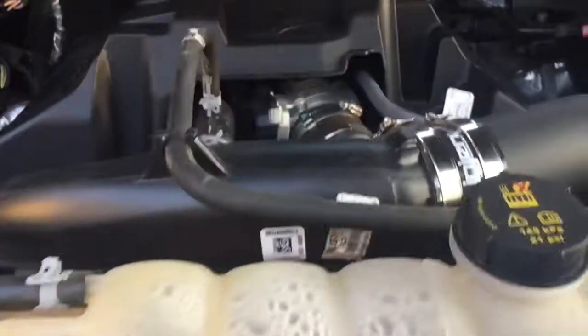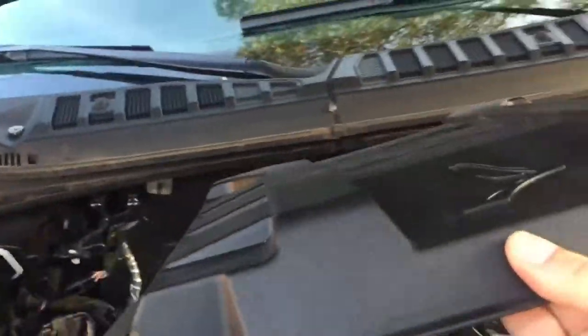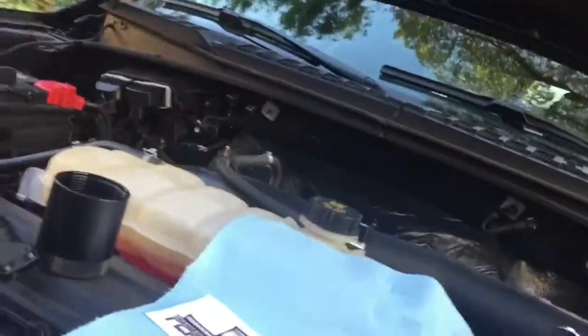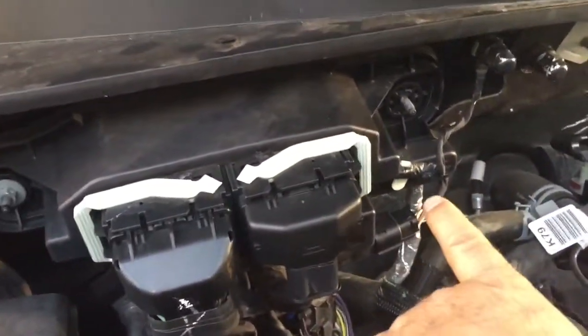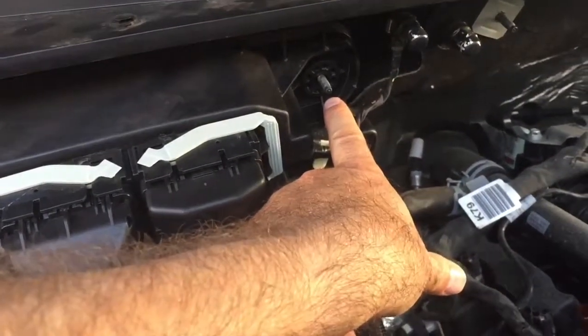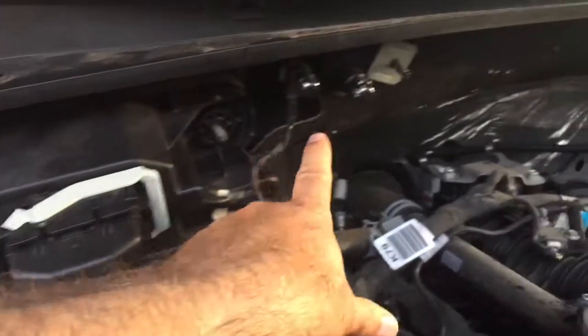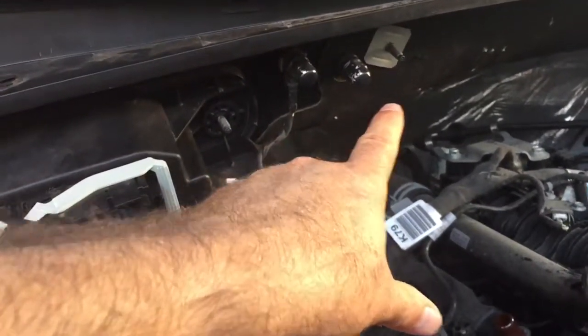You've got to take off two bolts — one there and one there — then your oil cap, and then remove this. What you want to do is connect your oil catch can to this bolt right here, not that one, this one. If you use that other one, there's no room to put your engine cover back on.